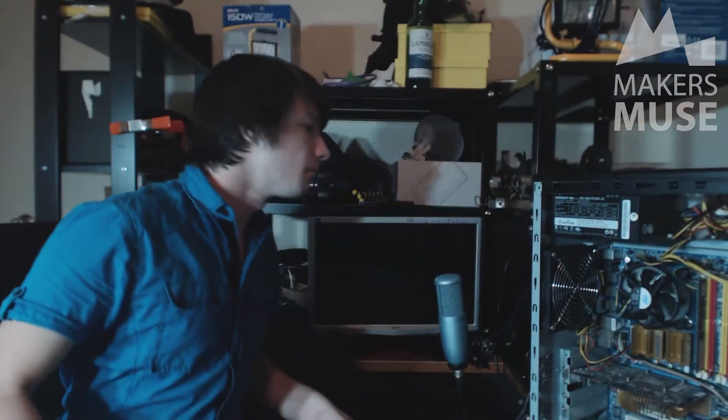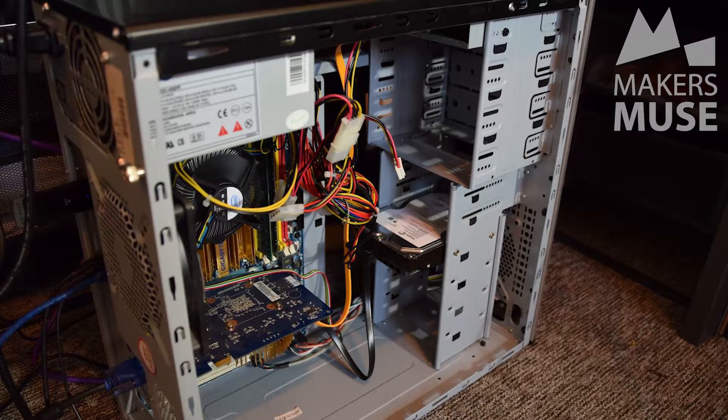All right, so here we are. Unfortunately I wanted to do the original test where I powered up in front of you guys, but I did that and nothing happened. It turns out this power supply — the Cooler Master one — is junk, it does not work, it's completely dead, which is a bit of a shame, but it was by the side of the road. I replaced it with the other power supply I had and it booted up fine, but then I couldn't get Linux to load via the USB, so I had to go to JB Hi-Fi, get a DVD, burn it, and then install from that — and it worked. Unfortunately I couldn't show all the steps, but the machine's all together, working fine, and nice and quiet.